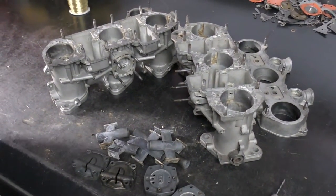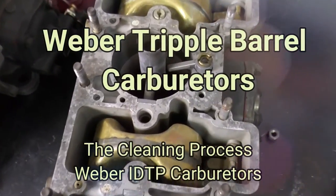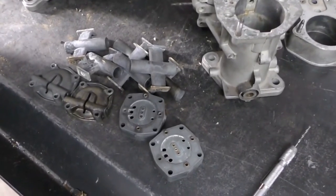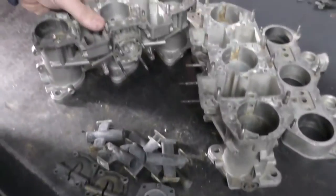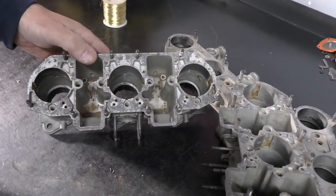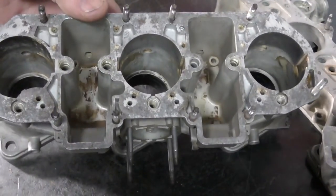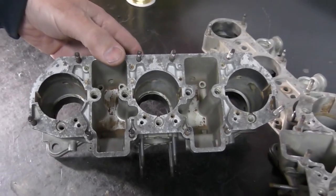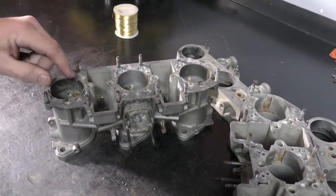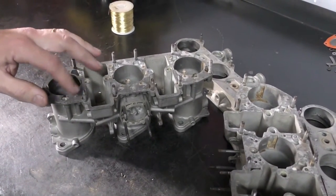The biggest part of this job is the cleaning. Having been cleaning these carburetors for the last 32 years, I've figured out what works best. Putting a carburetor like this in a soaking dip is not really going to give you much of a result, mainly because it's been sitting around — it's got a lot of debris, gasket staining, and corrosion issues that today's dip-style cleaners won't clean out. It also won't take off gasket surface debris that's stuck on, so you end up having to scrape, which creates leaks and seepage because you damage the surface.